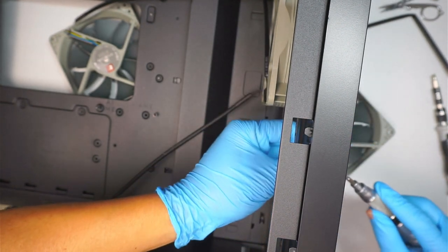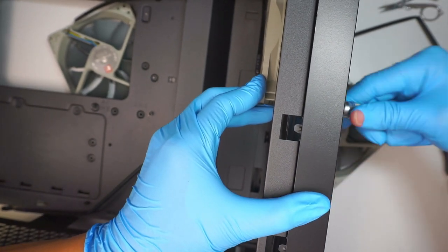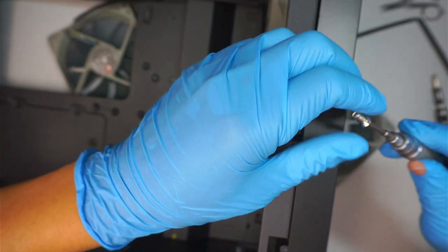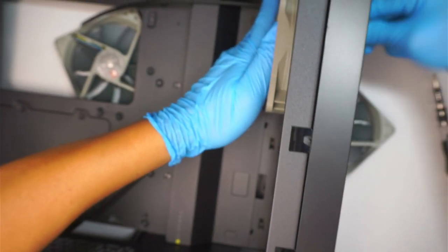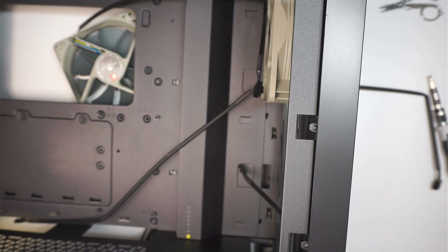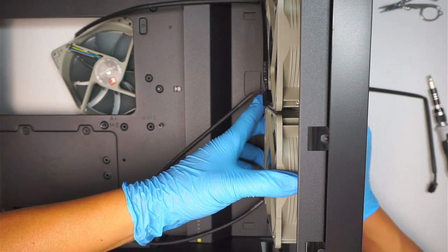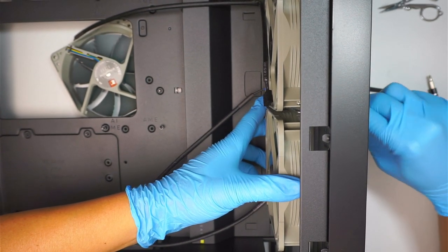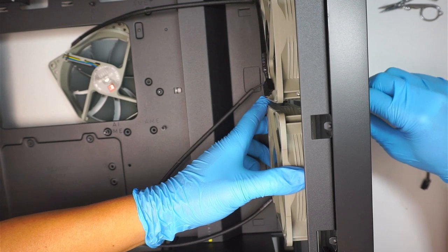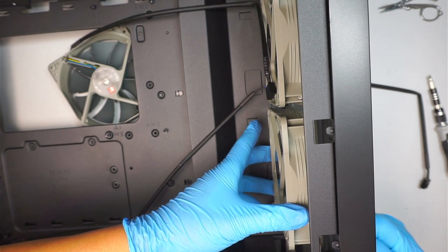I'll tell you the reason why I do not like to have the water cooling. The moisture here is too much, meaning the high moisture in the air, and over time the water cooling would get rust very easily, like on the case and whatnot. And again, computers do not like water, and if for some reason things break, then you would have problems. You never know what would happen, and then the leak happens to the graphics card or to your motherboard, then it's a nightmare.